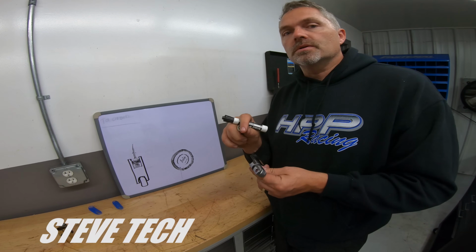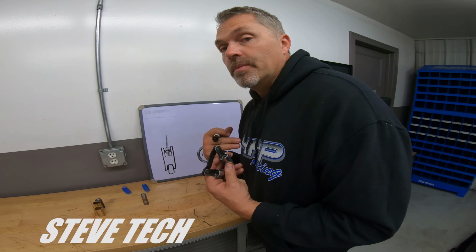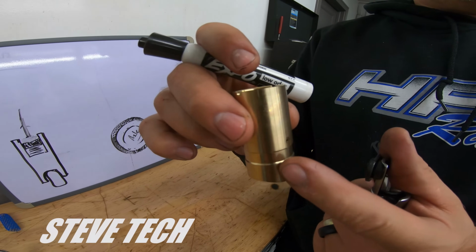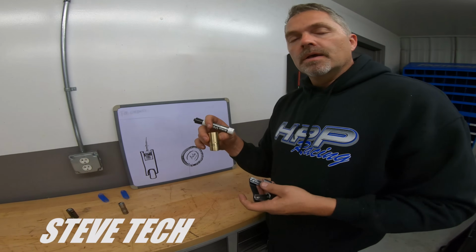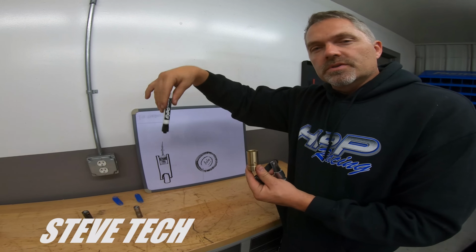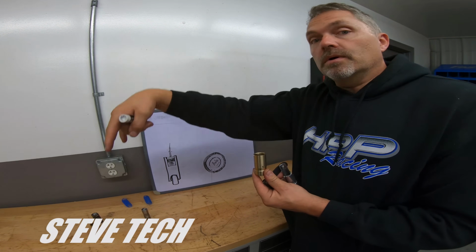Now you do have to have lots of oil to that lifter. It needs to have good oil pressure, good volume to keep everything cool and well lubricated, which in my personal opinion is the other reason why I'm not a big fan of the Keyway lifter, because there is really minimal oil that can go around the band, come up through the hole, then it's got to go to the next lifter, go around the band. By the time it gets all the way down the end, a lot of times if we use these, we'll need to put oil feed lines in the front, and then somewhere about three quarters of the way into the back of the lifter valleys, so we get oil back there, because not enough oil ends up flowing all the way through. The back lifters always have problems if you don't have these oil lines over there.